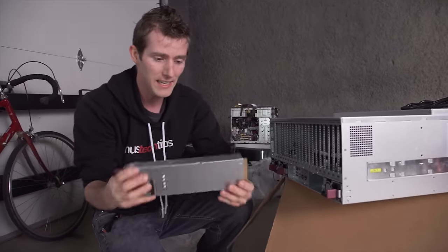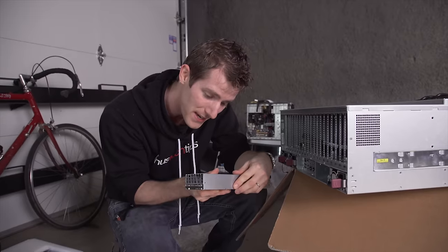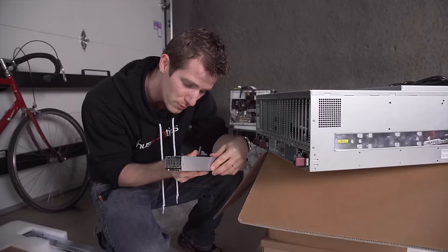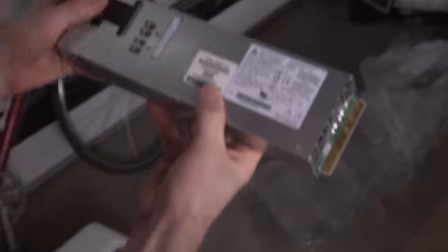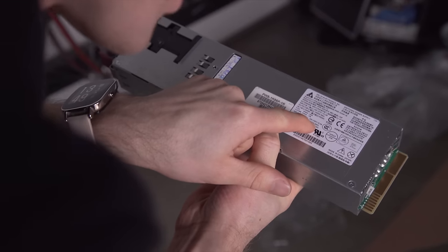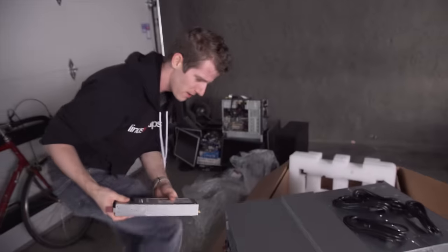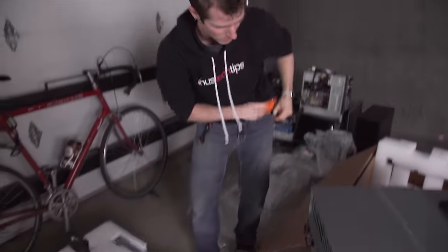You can see there are these tiny slim little units here. This is the DPS 1600CB. The output is 1600 watts max - and this is interesting, I have never seen a discrepancy like that before. At 120 volt input it's 1000 watts max, and at 240 volt input it is 1600 watts max. Very interesting. So I'm going to have to make sure I run this baby on 240 volt input. Let's see if Supermicro included an upgrade module kit or something like that. These are our rails - those really nice rails that I like - so we're going to go ahead and rail mount this baby in the rack.